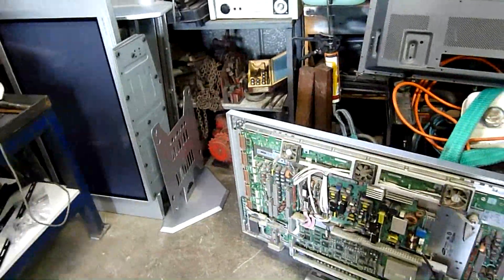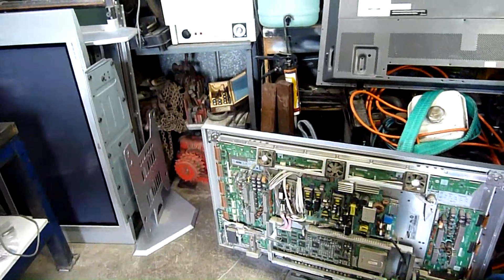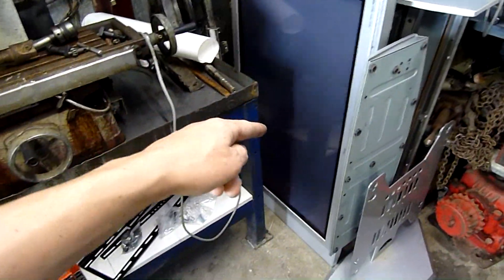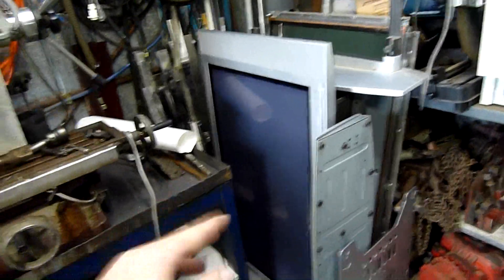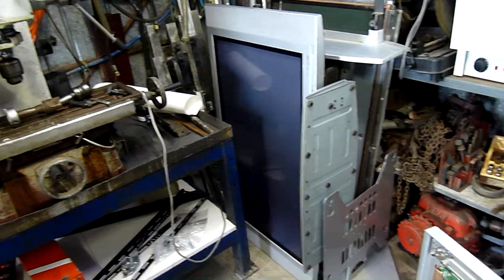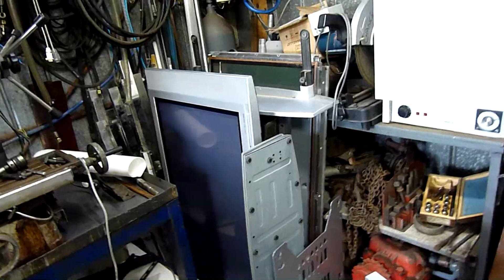Rather than just culling them all off, I'm going to try and fix some of them. There are just a couple of LGs that need to be stripped because they do have bad panels or possibly the driver boards at the bottom might be going bad. I'm going to quickly check that before I gut them, because that particular one there is clean and straight — I've got a remote for it and there are no real scratches on the front. The one behind it is all scratched up and pretty rough with no remote, so I don't care about that one. But the one Corey gave me on Thursday — I really want to have a quick crack at it. If it's chip-on-film that's bad, but if it's just an edge board at the bottom, I could probably get one out of the set behind it because I think they have the same panel.